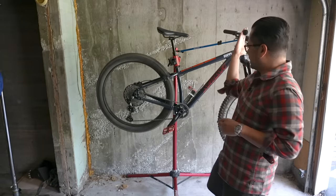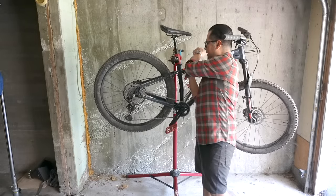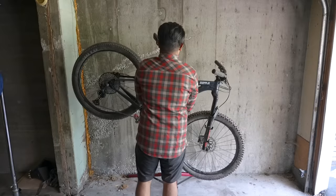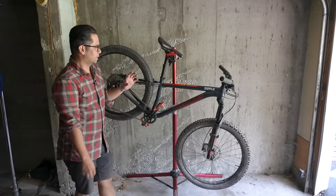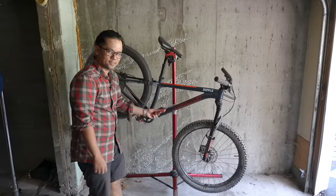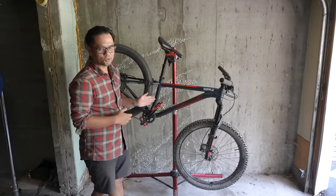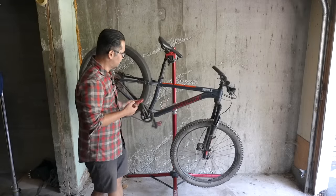So this is the Feedback Sports Pro Elite. To pop a bike off, I like to shoulder the bike, give it a little half twist, then hit the panic button — that pops right open and the bike is free. I'm going to demonstrate putting the bike on the saddle rest. There are lots of instances where you'd want to do this for a quick repair or with a bike where you can't clamp around anywhere safely. When it's like this, you have to be fairly careful not to hit the central column — my pedals are kind of brushing it. Not an issue if you run small SPDs, but with flat pedals, because the central column is straight up and down and doesn't skew away like the Park one, it's a little bit dodgier situation.